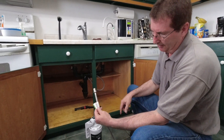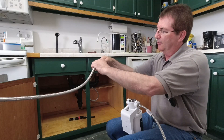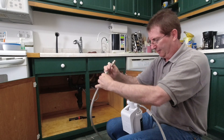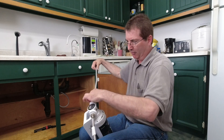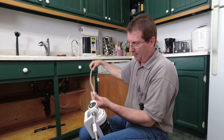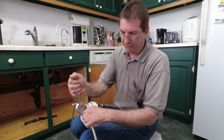It's even written on here: Inlet. And then this says stainless steel water hose and it says outlet. Stretch that out and we screw it in, then get a wrench and just tighten it up. You don't have to over-tighten it because for one it's a plastic housing and it's got a rubber gasket inside. Of course we'll check for leaks afterwards.